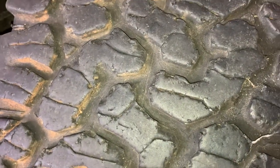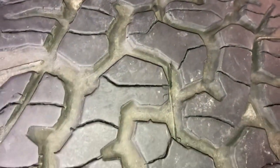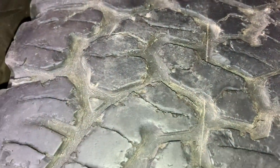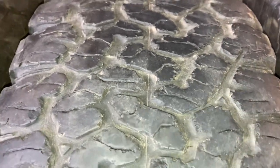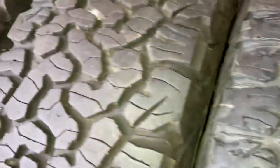Moving to the next one — looks very similar to the last one, got a little bit more rubber left, came off the same vehicle. But you can see on this edge here it's sort of feathered, it's lumpy, all these edges are rounded, so the only part making contact with the road is a high point that I can feel — that's going to have most of the contact. You can't compare that to a nice new flat tyre. This one here, worn not too badly but getting very low — certainly still road worthy. These wear indicators are about 1.5 to 2mm, so there's about 4mm there. But you can see they're not going to grip well in the wet at all. If you drive to the road conditions, follow the safety signs — those yellow signs in Australia, not just the speed limit — you'll be okay on tyres like this. But these are dangerous tyres; I'll totally agree with people that say they're slipping around, because these are the tyres that are slipping around.